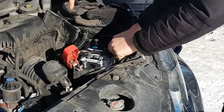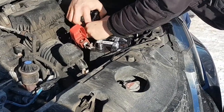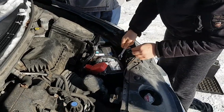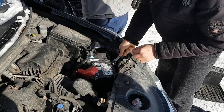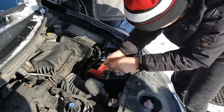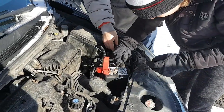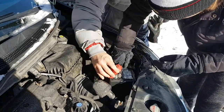Okay, tighten the nuts at the top, trying to do it evenly on both sides. Tighten the other one on the same side the same way. Now tighten the clamp with the wrench nice and snug so that the battery doesn't move around — try to tighten it evenly on both sides at the same time. Now put the positive terminal on first, making sure it's not touching metal.